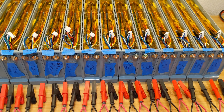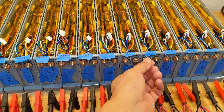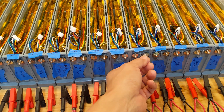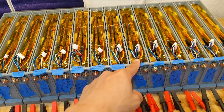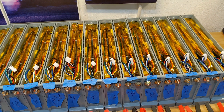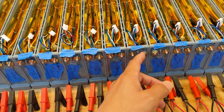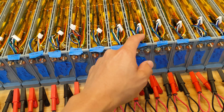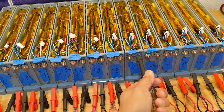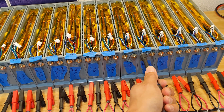On the opposite side, we often find customers forgot to tighten the N8 nut. That will basically create a voltage spike on that particular blade, and what you see in the Dr. Prius app is the voltage bar spiking like crazy and creating error codes. You can even transmit heat into the cell and damage it. So every time after installation, definitely check all the N8 nuts one by one. Make sure they are all torqued to spec.